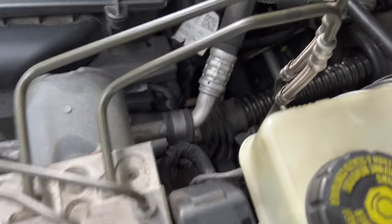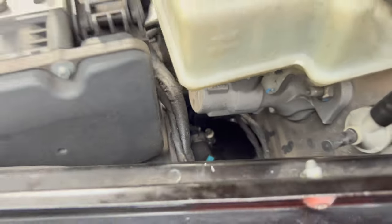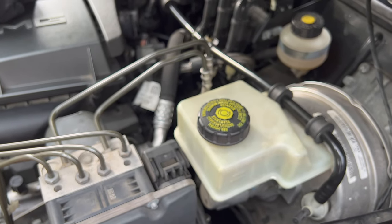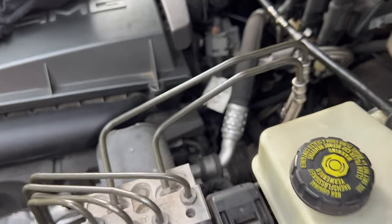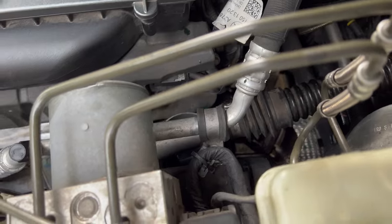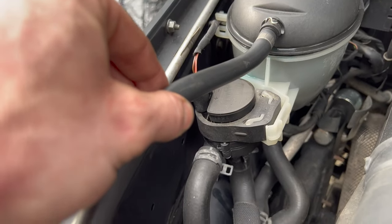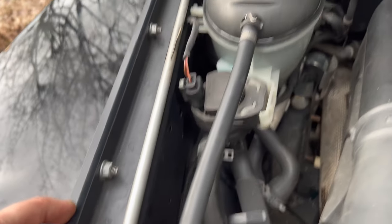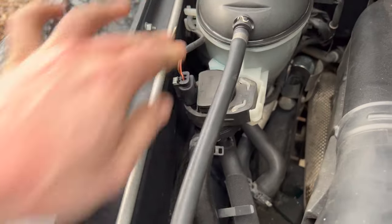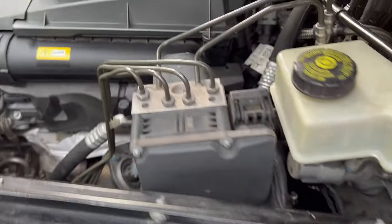The new pump is in, got all the hose clamps tightened up, and no leaks. I ran the engine for a little while. The pump actually did turn on — I just turned the ignition on, left it on for a bit, and the pump kicked on. Now I shut the engine off and turned the ignition back on and the pump doesn't seem to be turning on, so I'm not sure exactly what it's supposed to do. It actually looks like this same pump is on this side too, on the side of the expansion tank — same exact type of pump, but I think that one is for the heat exchanger on the turbo side.